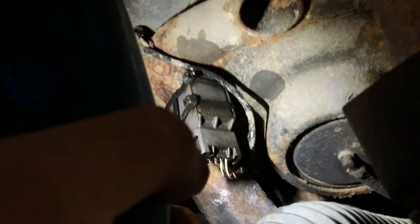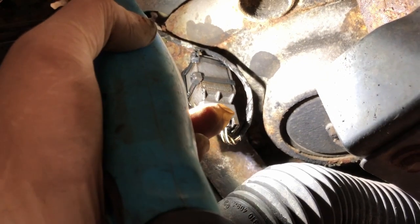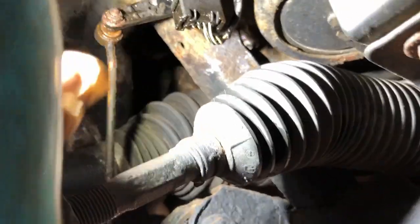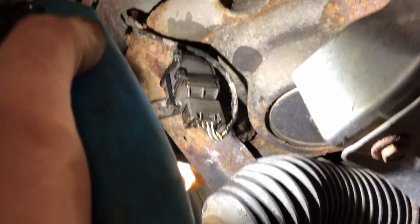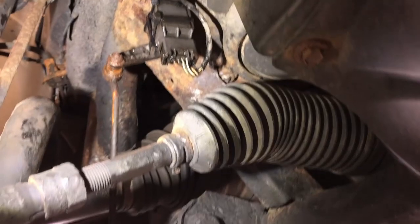Little update — I managed to repair the height sensor. What happened was the screws fixing it to the bracket had ripped out because the pivots had seized, so when the suspension was moving up and down it just ripped it off. I've lubricated the pivot points and refixed it with zip ties for now — that's a temporary fix, though it might end up being permanent because it's rock solid. Ideally I need to buy another level sensor, a secondhand one rather than new since they're cheap and poor quality.